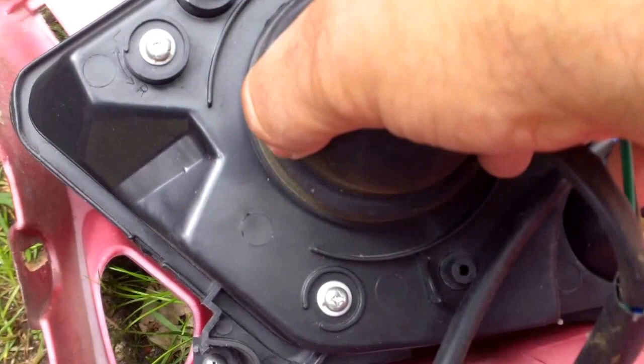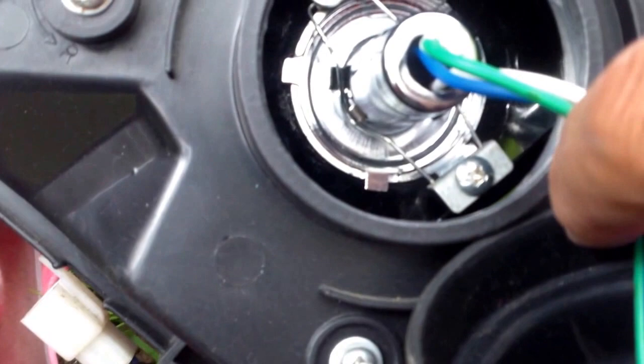Here I've got the two headlight bulbs — I got those from Amazon last summer but never had the chance to put them on, so I'm gonna replace them both now with the new headlight capsule. To remove the light bulb, you're gonna pull the plastic cover off to expose the bulb. There's a retaining spring in there — you push down in one corner, and you may have to loosen the screw a little bit. Then push down one side, push down the other side, and up it goes.